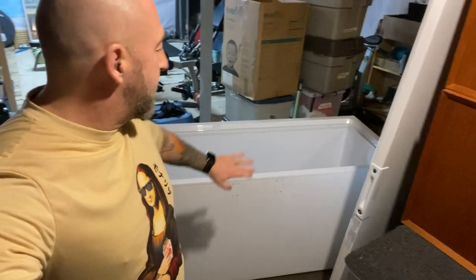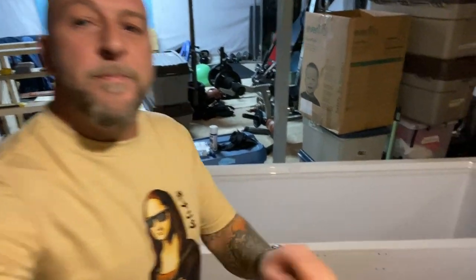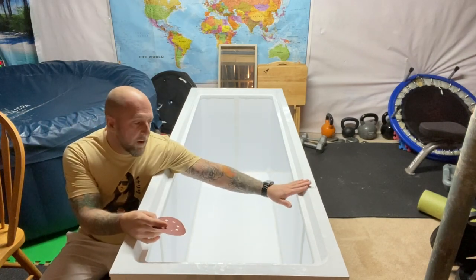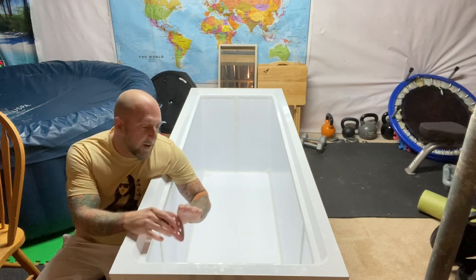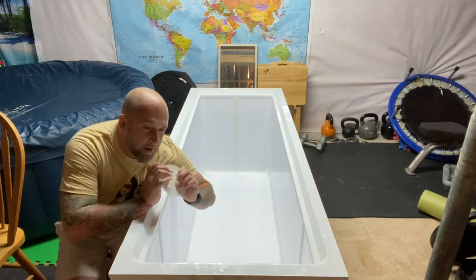Now the next step is to just scuff the paint, not to the metal. They said 60 grit, but 60 seems too gritty to me, so I'm gonna use 80. You just wanna get the paint scuffed up a bit. Okay, I got some 80 grit sandpaper here. You wanna do the tops, do the sides, scuff up the water weld a little bit. But like I said, don't go through the paint, because that will attract rust. So I'm gonna just lightly scuff this.